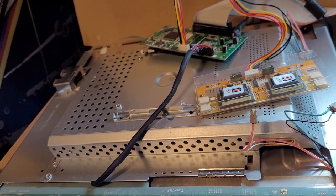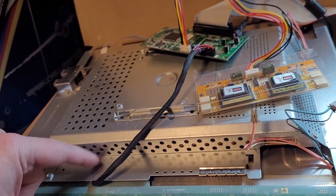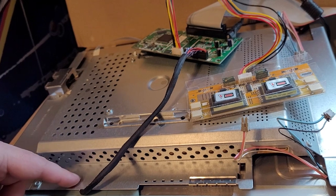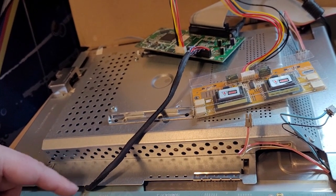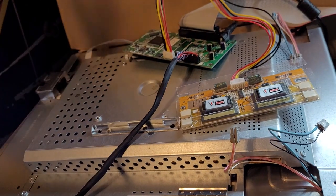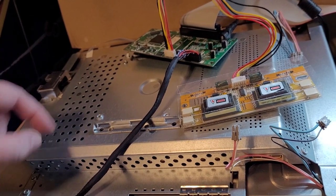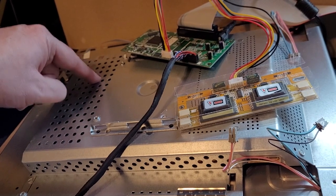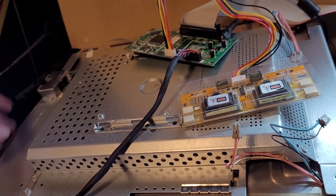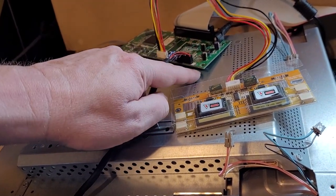Basically I just bought the LCD controller kit, took the LVDS cable, and took out the one that was in the Dell. I plugged the new one in here, then took the panel off — four screws on the side — and exposed the LVDS cable. I unplugged it from the inverter board inside. Once I did that I plugged the new cable in, put the panel back on with the four screws — leaving the cable coming out for the proof of concept — and plugged that into the Arcade1Up PCB.